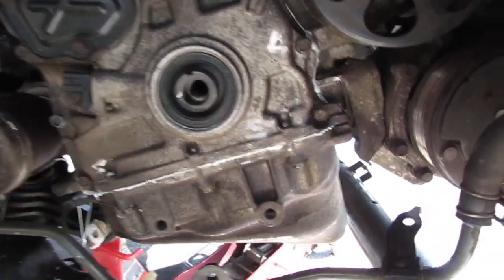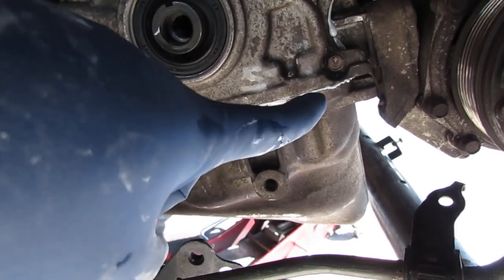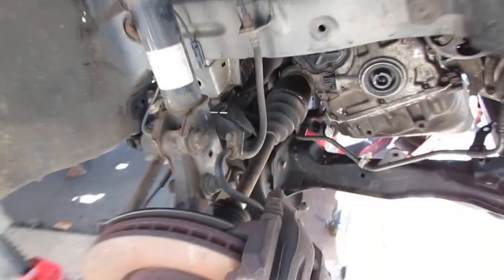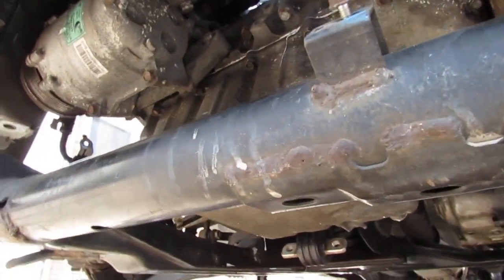So there we have it. Oil pan's in. You see why I waited? Because that oil pan will seal the bottom of the cover. So we have to do this in three passes. See, the subframe is just hanging down. It's hanging down by two bolts, one in the back on both sides. Just loosen them, don't take them all the way out. Just let the frame hang down. And there you go. So we're gonna tighten that up in three passes.